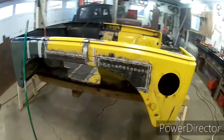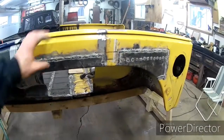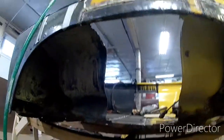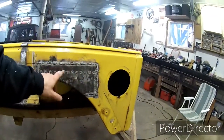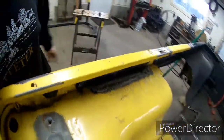We managed to get a few patches put in. This patch runs the length underneath the extension, and then underneath we broke the edge over. It doesn't have to be fancy - it's all going to be hidden. These are all the plug welds in order to reattach to the patch on the back side of the fender, because there was a strip of rust in here that we cut out.